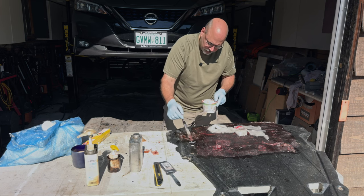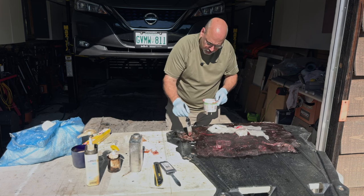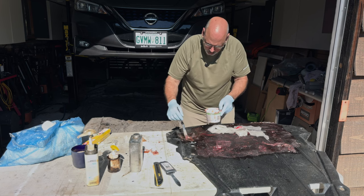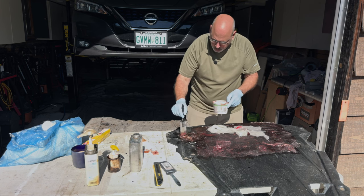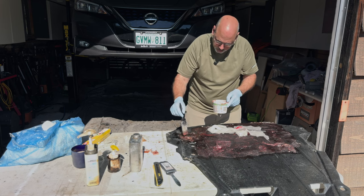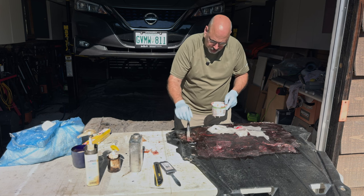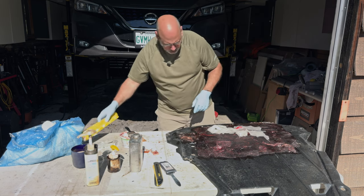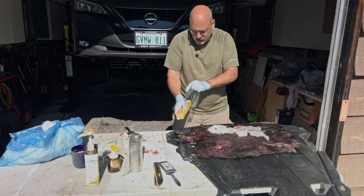No one's ever going to see this, and quite frankly, it's really just there more for winter and also for aero. Because if you have one of these panels with mount points that are damaged, invariably you'll see people driving around with the aero panel dipping or dragging down, which is not good for efficiency. And it's certainly not good in the winter because you'll be picking up salt and all the other nasty stuff you don't want in the engine bay — or the motor bay, being that this is an EV. Gas car, EV car, doesn't matter — it's the same deal. A lot of these cars, this one has a bit of an insulation value to this piece, probably in cold temperatures to keep the engine bay area warmer. As cars become more efficient, it becomes more important to keep that warm.